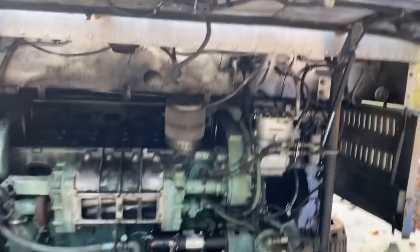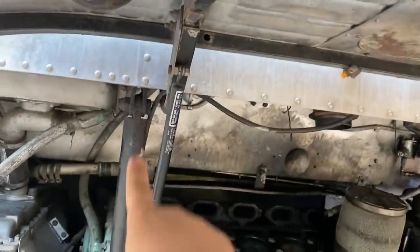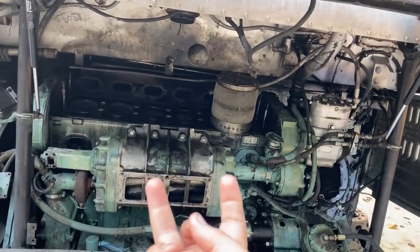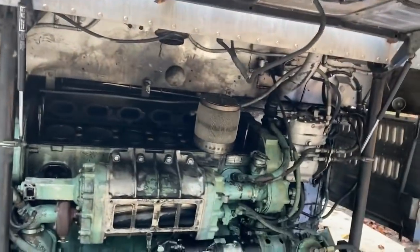So these things, about 2 hours, I'll have this engine out of here when I go to do it. There's 2 bolts here on this big post that comes up, that bolt right there, and that big bolt over there. Once you take those 2 out, it just pivots down on 2 hooks on the back. And once you take the 2 bolts out of the hooks on the back, so it's the four attachment points, the 2 hooks on the bottom, and then these 2 right here, this will come right out as one big power plant.